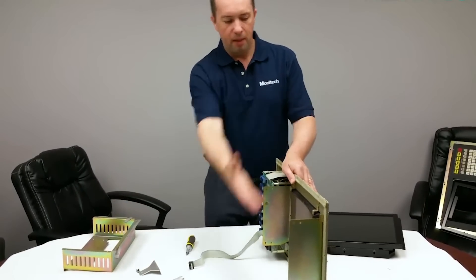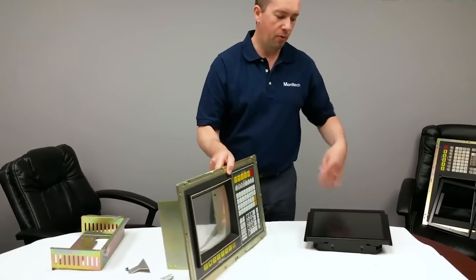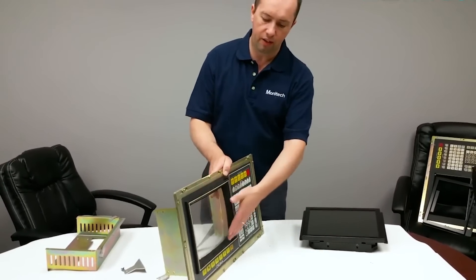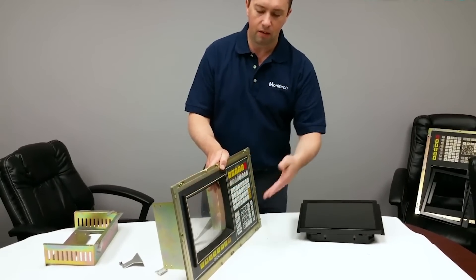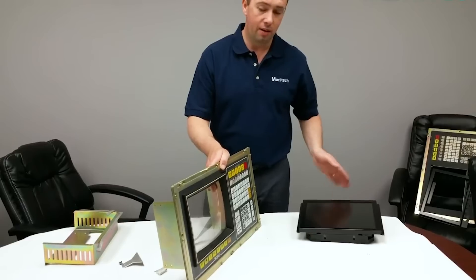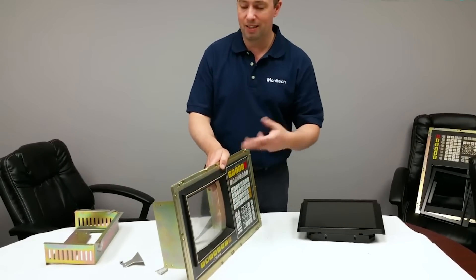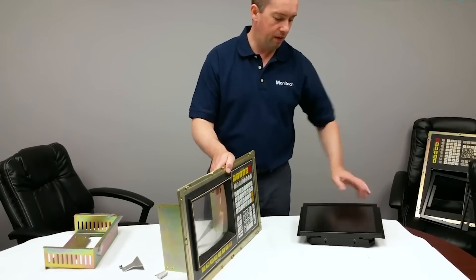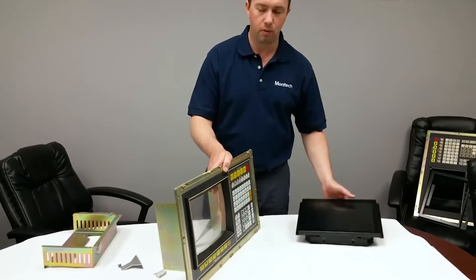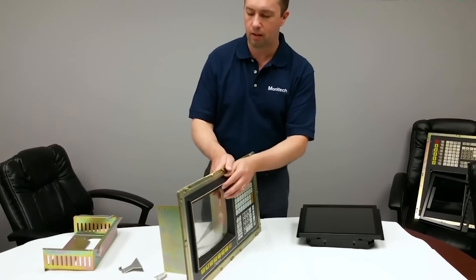You're going to be left with the front panel, and since we're putting a larger 12.1 inch LCD screen on the front, we're going to have to remove the front bezel to make it all fit. This particular design was designed to mount on the front, which actually makes it easier to do the install. It has an anti-glare glass on the front, so you don't have to worry about glare like the original plexiglass, which has a really bad glare on it.